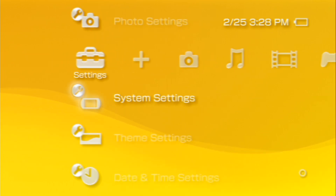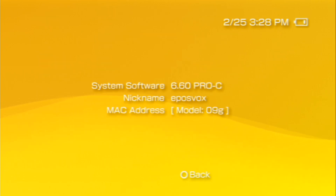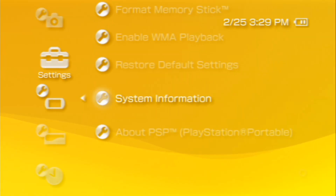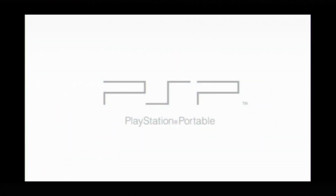Now this is a soft mod, which means it's not permanent and won't damage your system. So every time you completely shut down your PSP — by holding the power switch for 10 seconds, the battery completely draining, or removing the battery — you'll have to run the Fast Recovery app from the menu to reactivate the custom firmware. If you have a supported 1000 or 2000 series PSP, it's possible to make the custom firmware installation permanent by running the CIPL Flasher. If your PSP model is not supported, it will just tell you so.